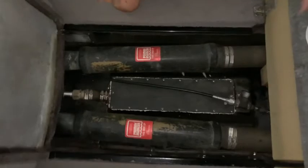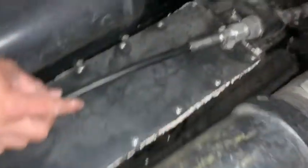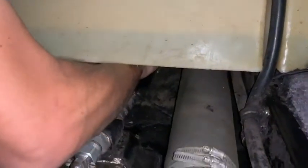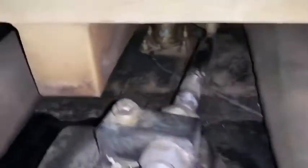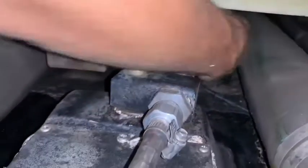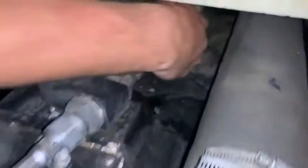You pull out the back seat and pull up the back panel — I have the back cushions off right now because we're redoing upholstery. You have to undo the rudder down under here. You can just reach back and grab it and pull it forward like that, turning it all the way right. That brings the bolt up close here where you can undo it — it's on the bottom here, I believe it's 7/16, maybe a half inch.